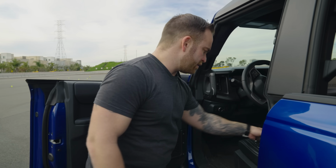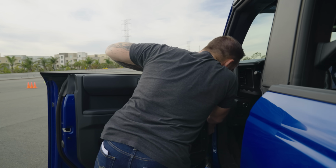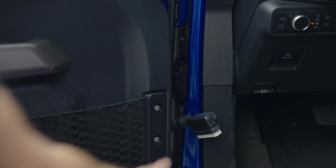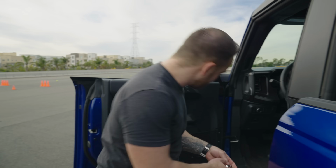And then the second thing you do, take out the wire harness. So, simple little wiring harness there. That was probably the easiest thing I'll do all day. And there's a hinge door there so you don't get water in the female part of that wiring harness. And this comes off with the door. Before I put the bag on the door, I'm gonna take out the bolts, the pin bolts, then I'll slide the bag on and we'll go from there.